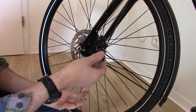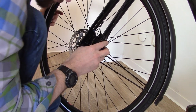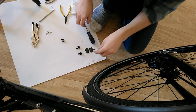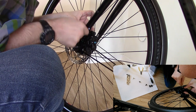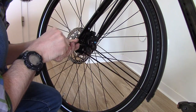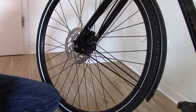The final step is to reattach the caliper. We've cleaned the disc and now gently jiggle the caliper onto the disc — hence the importance of retracting the pistons fully. With it seated in place, take the two screws and screw them back in; in theory the caliper will be in exactly the same position it was when we took it off. That should be job done — but proof is in the pudding, let's go outside and try it.